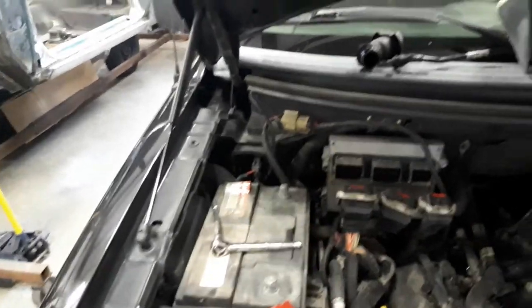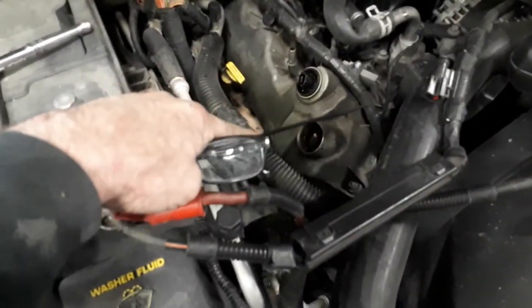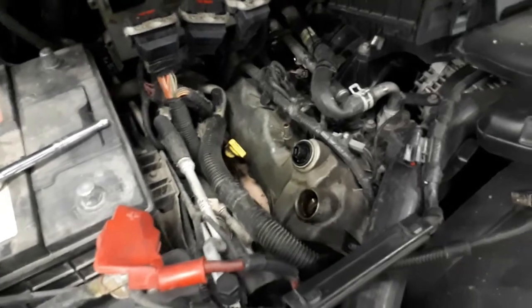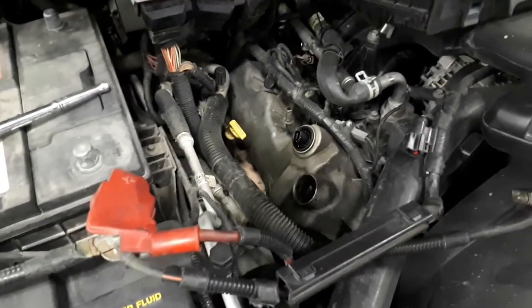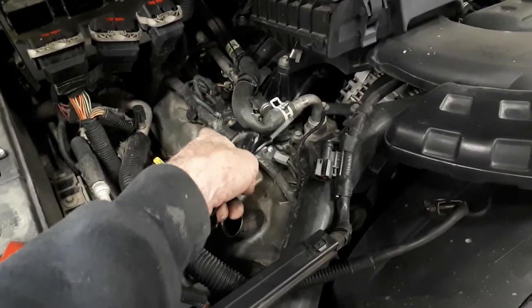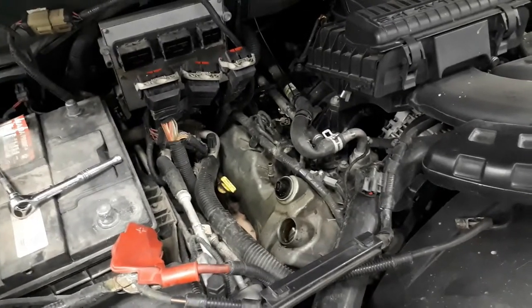I took the battery cover off, giving me a couple inches of extra space. I've disconnected my negative cable and ground lead from the battery and the firewall. I've pulled that stuff forward, removed the oil fill spout from the valve cover, disconnected the wiring to the VVT solenoid itself, and disconnected the PCV hose that goes up to the air breather. Tied that water hose back so it's out of the way.